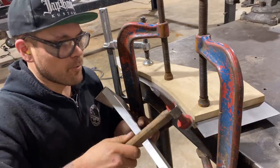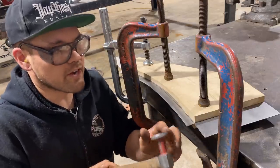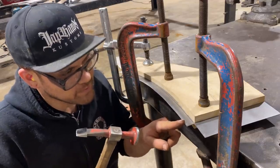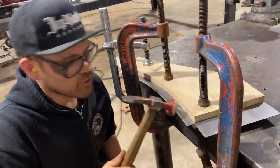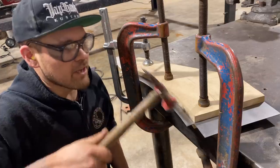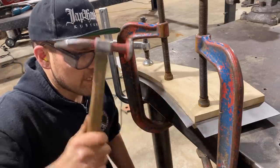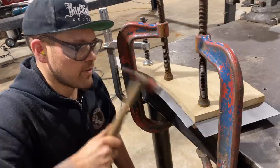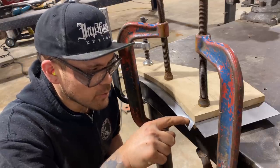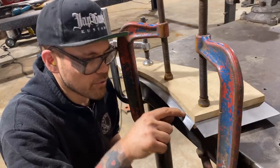And when I'm hammer forming this over, I'm gonna just start and show you. There's kind of a trick as to where you're gonna hit. Like if I keep hitting on the very edge, like the tip of this flange, and just start bending it over and trying to hammer it all down, it makes a little bit of a mess. So I try to methodically go across here without doing too much at once. But after I initially get this started down, now I wanna hit closer to this line to start and make sure that that bend is crisp right there,